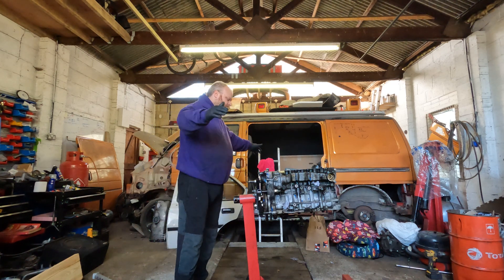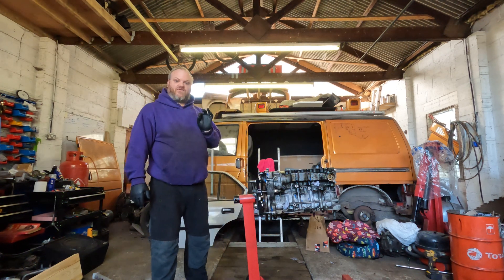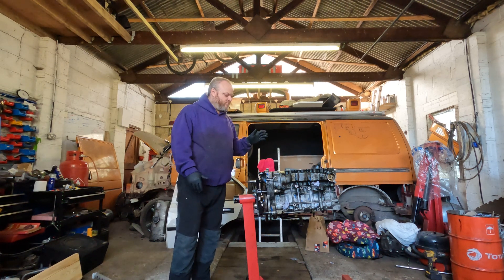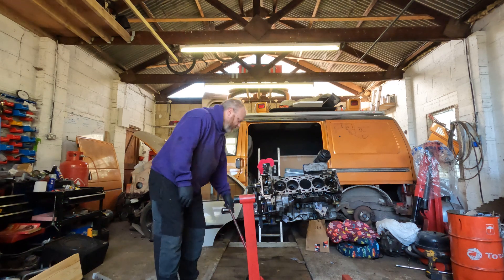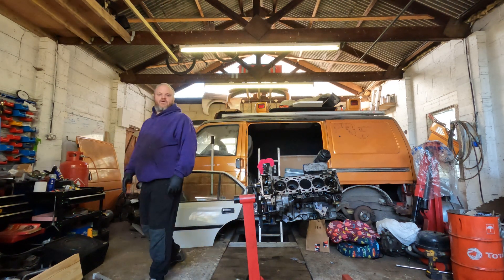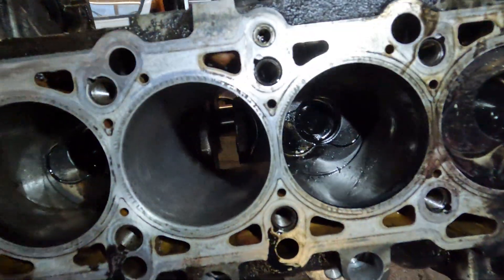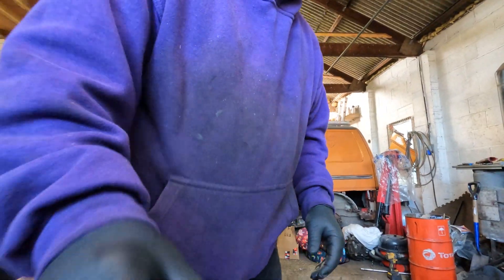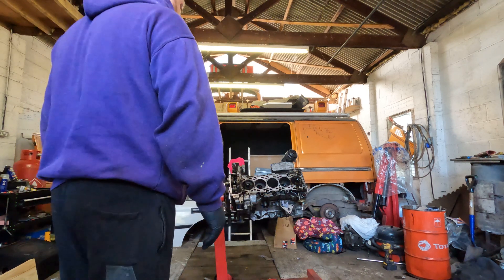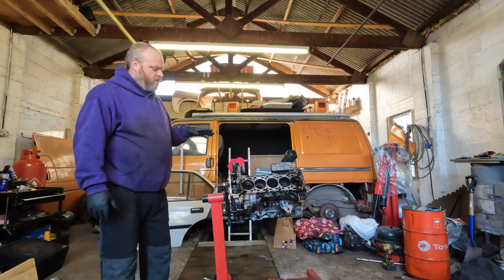What I've done today is taken the cylinder out, cleaned it, and made sure there's no pitting or chips in the nickel coating. I'll show you quickly — I use a torch and look down the bore. Here's my good cylinder — no chipping or damage at all. Any nasty scores down the bore will also spell game over; a real nasty score will end your game.